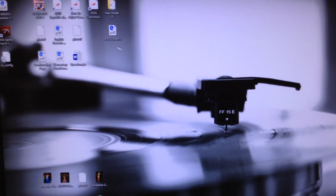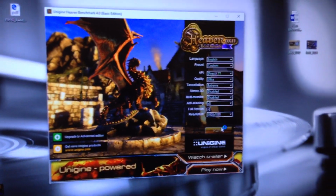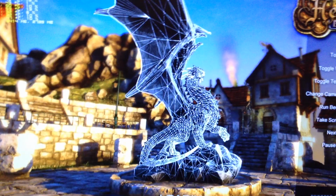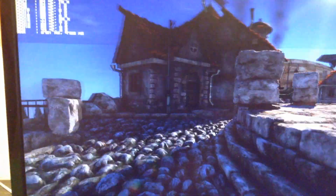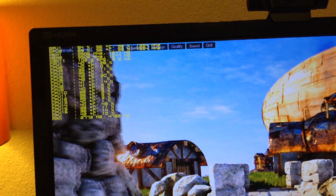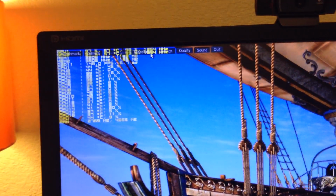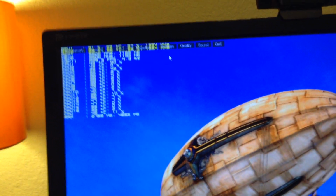The higher your Uncore, the quicker the whole subsystem is, and it really helps with everything. So we'll get this going. Everything's maxed out here at the 1080p level. So we're sitting right at about 100 frames per second here. Leave the two cards at stock. The only thing I do is bump up their power target to 125, and that lands us at 1354.